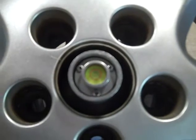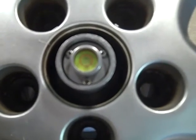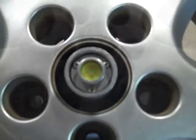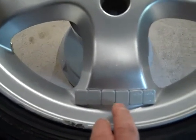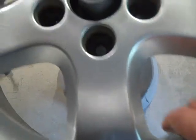Now the next two wheels — I know I didn't get the red dot exactly at the valve stem on these. Wheel number three: the bubble is still within the red circle but it is slightly off center, so I'm going to put some weight on it. Theoretically if you're within the red circle it could be considered fairly well balanced, but let's narrow it down more precisely. These weights come in longer strips — this is a previous strip cut when I balanced other wheels — six pieces of a quarter ounce, which is one and a half ounces total.